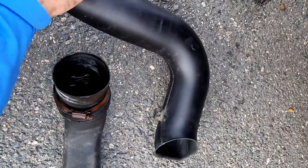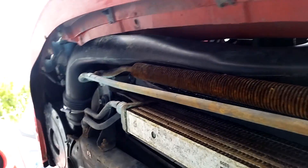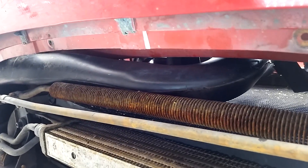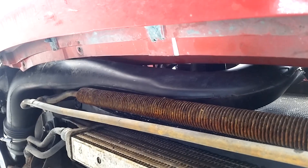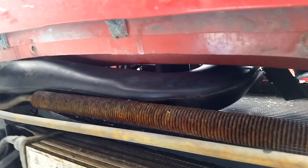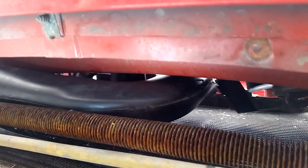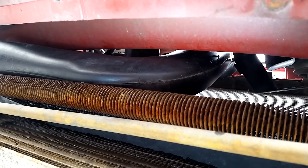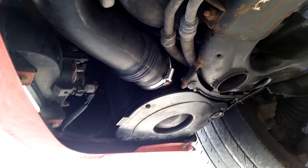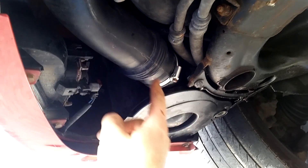Let's put the new diesel snorkel into the car. My hunch was right — this pipe is so big that it's really a friction fit to get inside. I tried for a few minutes just to lift it in without pushing it but it wouldn't go. So I had to use a bit of force, pulling on the spoiler to the side and pushing it upwards. Now I just need to connect the hose clamp, put the horn brackets back on, and put the upper bolt back in. It is always a bit fiddly to get the pipe onto the air filter housing, but you just need to wiggle the pipe back and forth and it will pop on. The hose clamp is on, the bolt up behind the grill is in, and the horn brackets are back too.